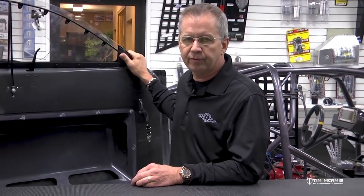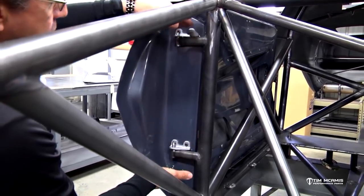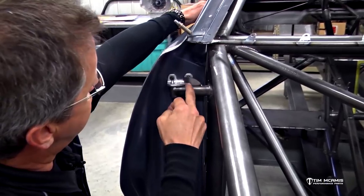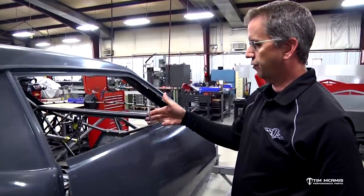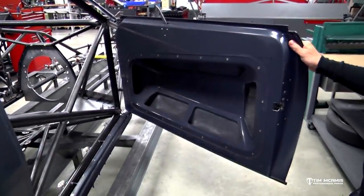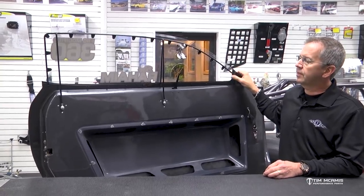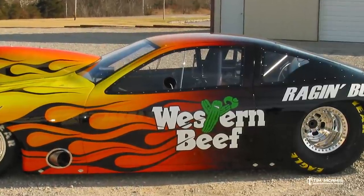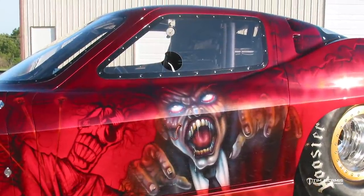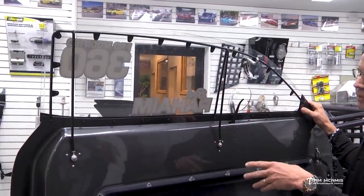So a lot of times, if you're lightening up your car or you're changing from an existing door to a lighter door to save a little bit of weight, most of these doors just have the bottom half of them in carbon fiber or fiberglass, but the top half of the door where the window is doesn't really have any frame around it — doesn't have anything to support the Lexan. There are a few body styles that do, but only just a very few. Most of them are going to be configured like this door here, which is for a late model Camaro body style.